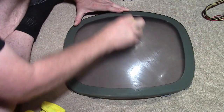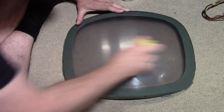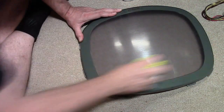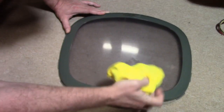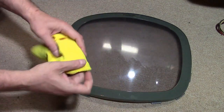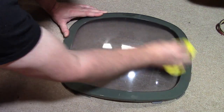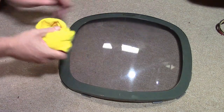I bought one of those headlight cleaning kits and it starts out with a really coarse sandpaper — you've got to go through a whole lot to get it to be polished clear again. That means you end up removing a lot of material, and unless you have deep scratches you really don't need to do that. So we'll let that dry and then buff it out. When I say buff out, what I really mean is come in with a sharp stroke and constantly rotate the cloth. Once the bulk of this polishing compound is off, then we'll go over and buff it in a circular motion.